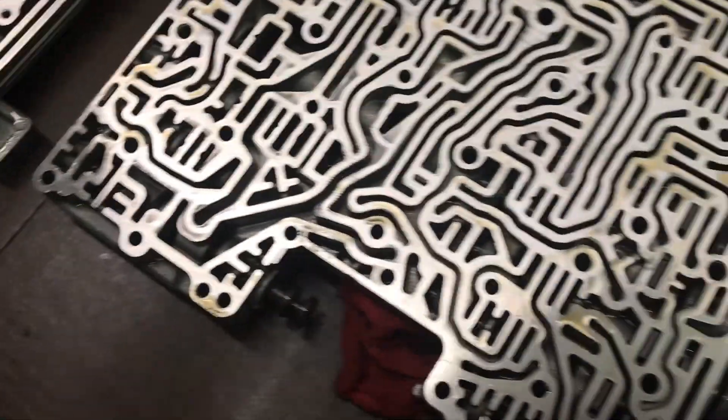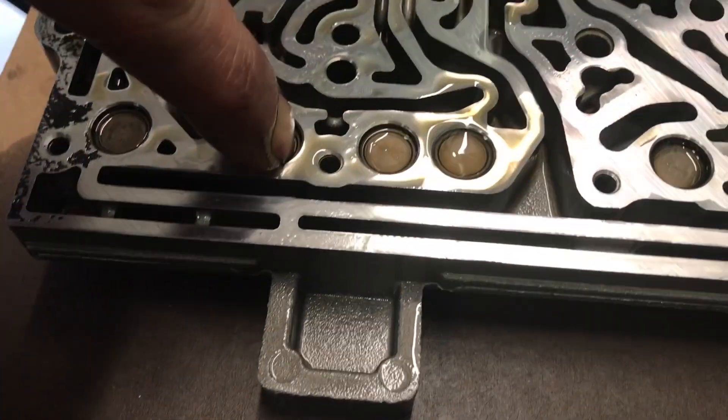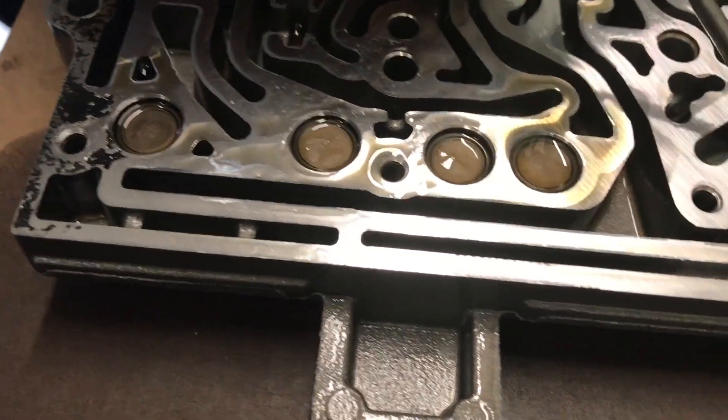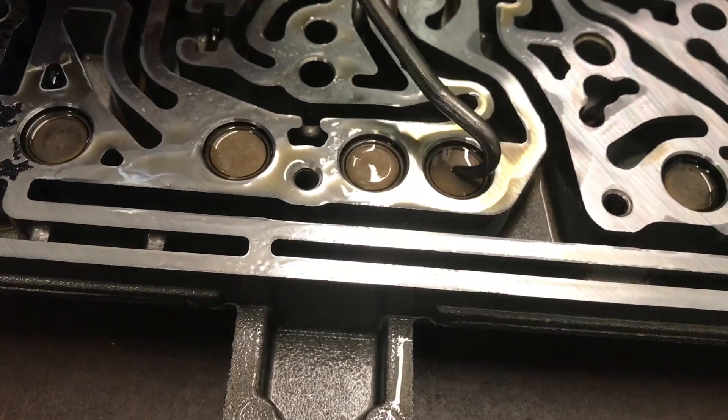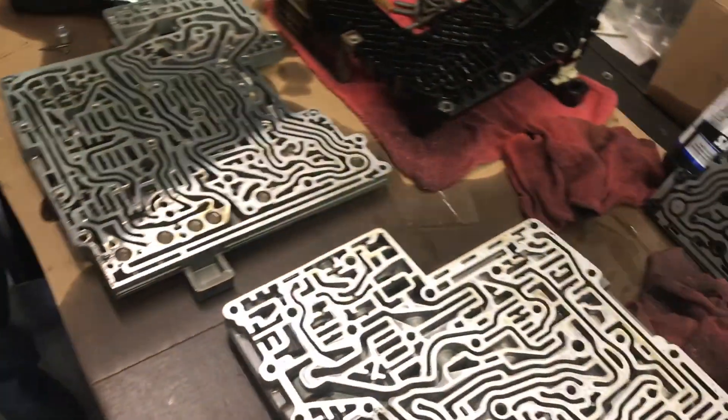It's an O-ring end plug that we put in, and then there are a few springs. These accumulators control the quality of shift. As you can see when you push them down they should spring up, but they're a little slow — this one is stuck down completely and this one still has a little spring to it.